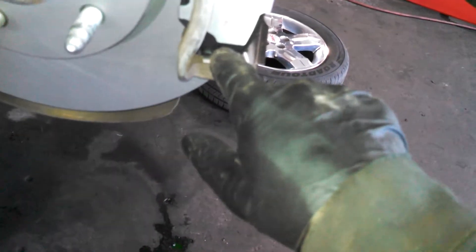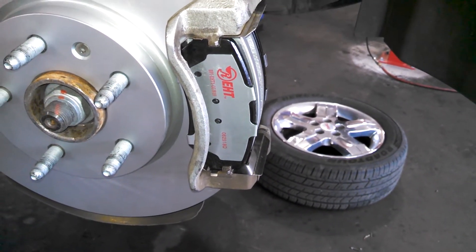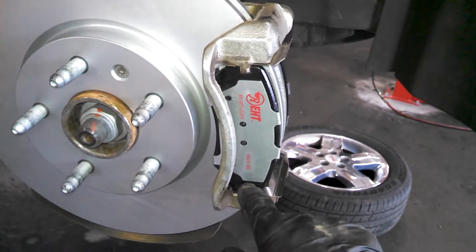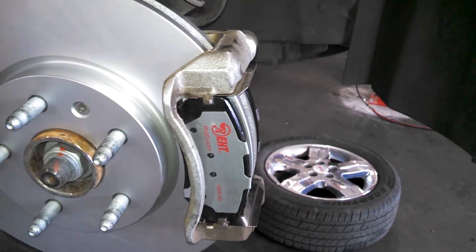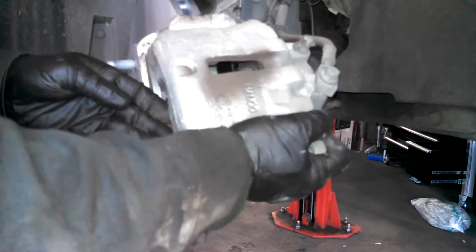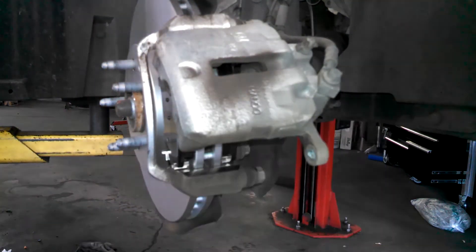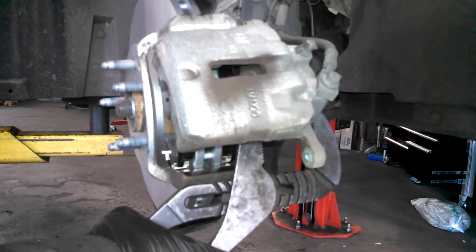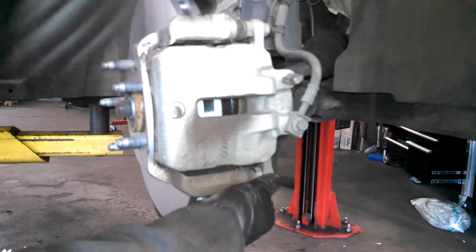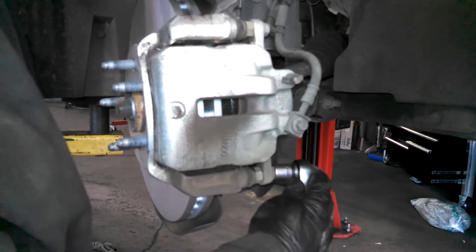You can put a little bit of lubricant on the brake pad where it contacts the metal. I feel pretty good about it with the new hardware, but if you're using old hardware, or you don't drive a lot, or you're in a rainy or rusty area, consider a small dab of lubricant on the contact points on the brake pads. Collapse the piston just a smidge.